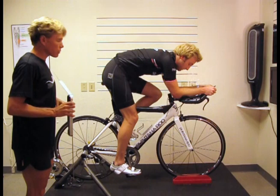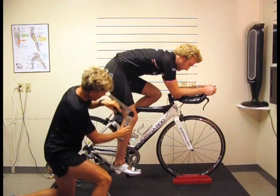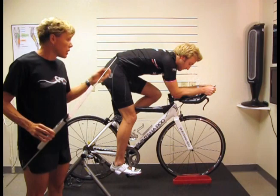because we're going to get another number of reference we can use to get the correct seat height. What I'm using now is an angle meter. I'm going to place this on the knee joint in the middle. The other one will be going down across the ankle. Then we move this in line with the hip to see what the reading is. This gives us 138 degrees. Once again, ideally we'd like to be around 145, so this suggests that Robbie's seat is too low.